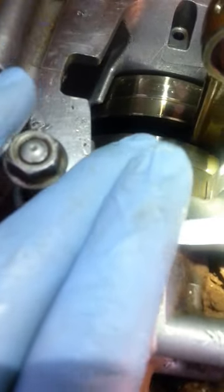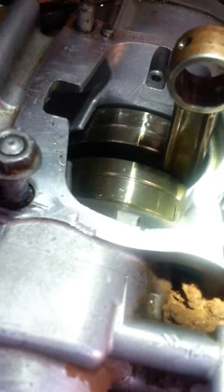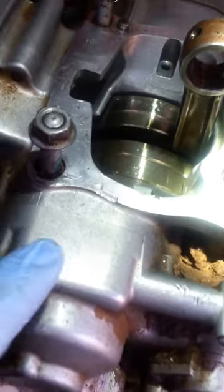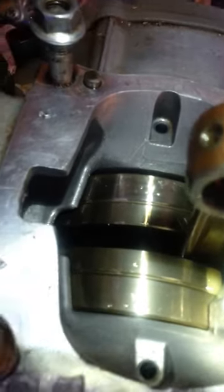Like I said, you're going to want to use the cotton swab and stick — the 'stick method' I like to call it. That's an easy way of cleaning out anything that fell down inside your crank without splitting the whole case. That saves you a big hassle. Most people would say you need to split the case, but it's too much of a hassle and too much work, and most people don't have time for that.